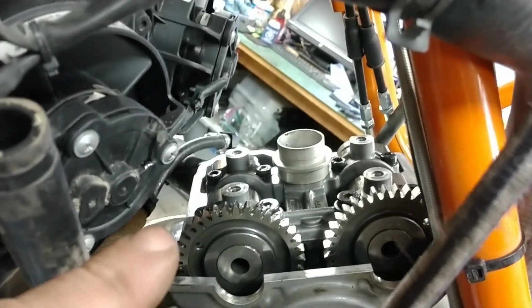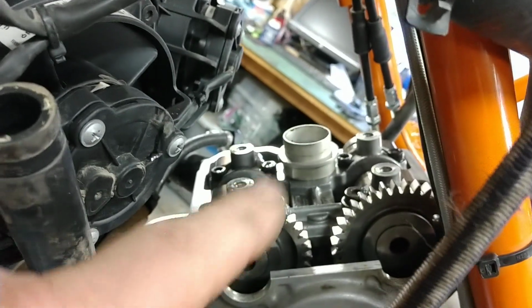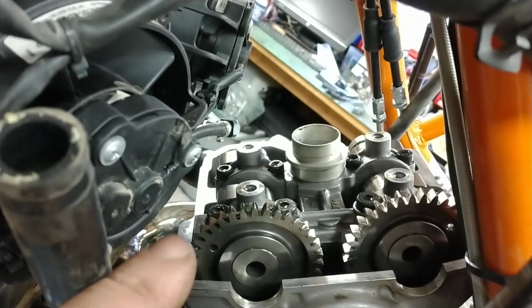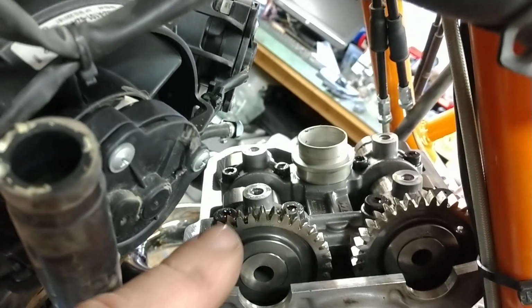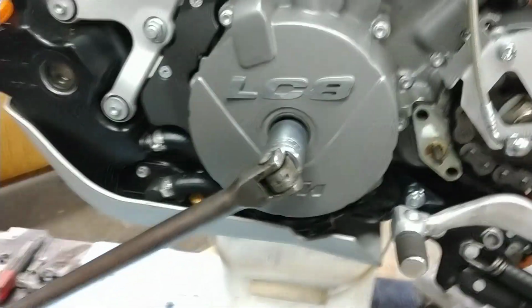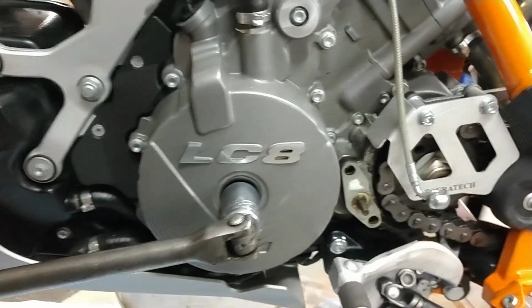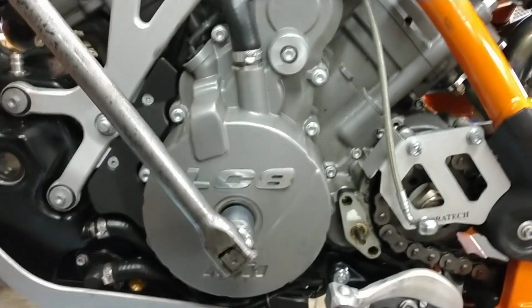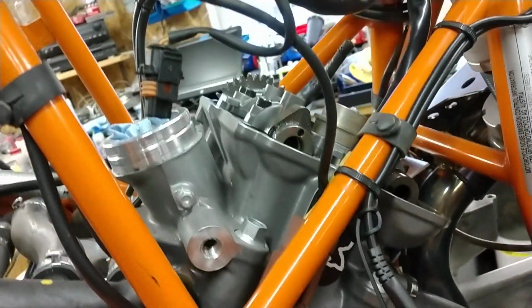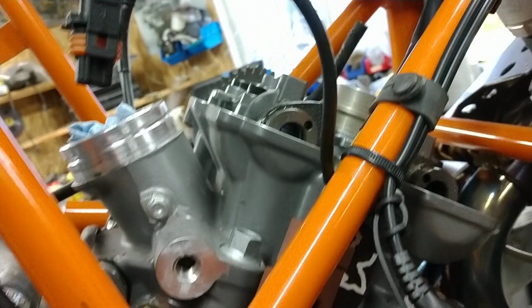And if I need to change anything, I would take the bolts out, take the tube out, take the cams out, make the changes that I need to make, put this cam bridge and assembly, cams and everything back in together, and then I turn the crankshaft back clockwise to the point where the rear cylinder is then at TDC, which is really close to right about there.